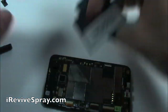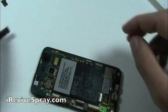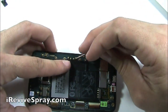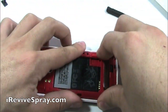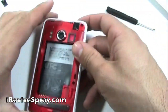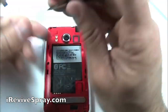I made a mistake right here — forgot to put that on. It doesn't really serve any functional purpose, but cosmetically it just looks good. Make sure that you don't place it over too far to the right where you're going to cover either one of those gold tabs, because those do need to connect up to that red backing. Work your way all the way around the phone — all those tabs just snap into place, and then we're going to reinsert the 6 Torx screws again.